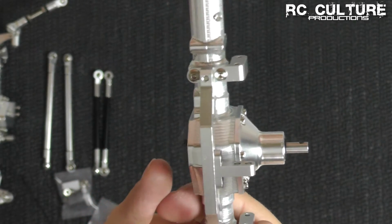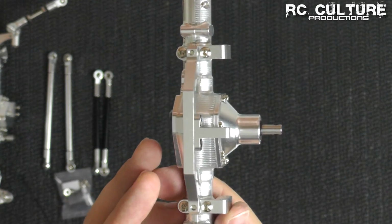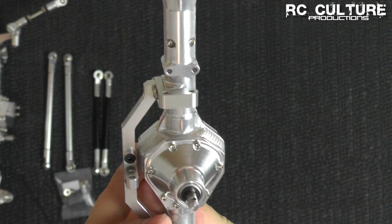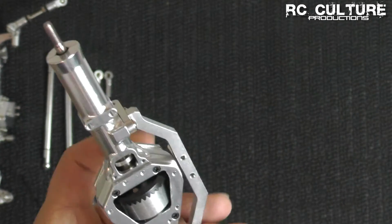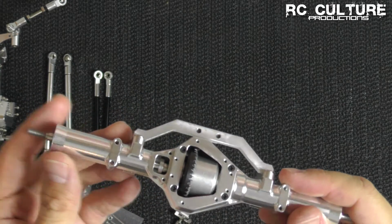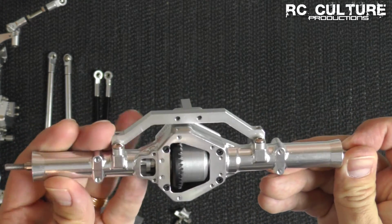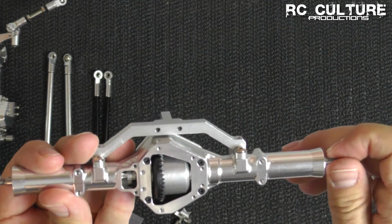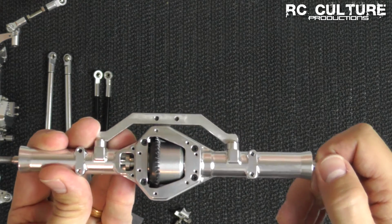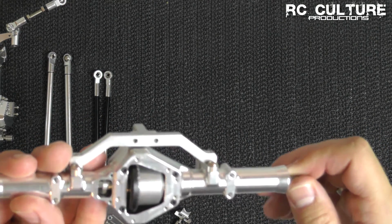I think if you have a long wheelbase vehicle, then being able to shift the differentials so that you can get a better steering radius is definitely going to be something that could be fun and/or interesting for you. Having locked axles front and rear on a long wheelbase vehicle means you have a very, very wide turning radius, which makes it difficult to do any trailing or anything else with. Whereas if you could shift the differential, unlock it when you need to really turn tight, lock it back up when you need to crawl, then it makes that vehicle much more versatile.